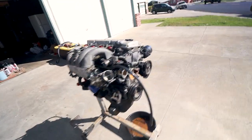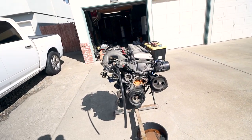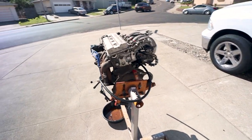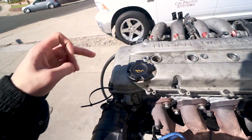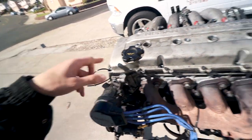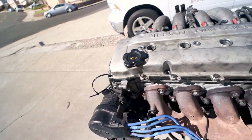Here it is - this is the new powerplant of the 240 that I own. It's pretty much almost there. There's only a couple things I need to do. Say if you're getting into redoing your KA, this is how I did mine and I think it's pretty good. For now, I need to change the valve cover gasket and then helicoil the block so the valve cover can thread on, because this hole right here is stripped.